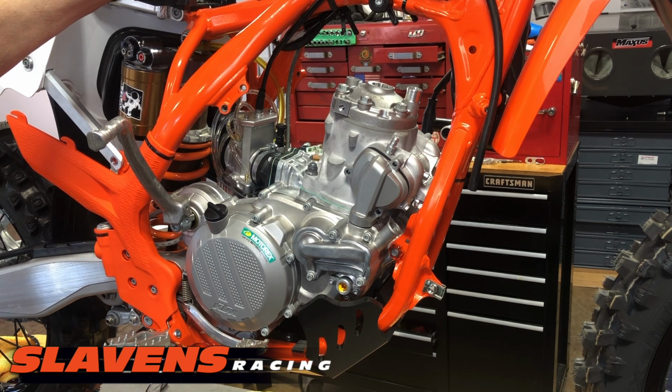but just ride the damn thing. Don't do heat cycles in the garage. That does absolutely nothing except get a bunch of grunge inside your pipe and on your power valves and in your muffler packing. So do not do heat cycles. That is something we did about 50 years ago when we had cast iron cylinders. These do not need that.